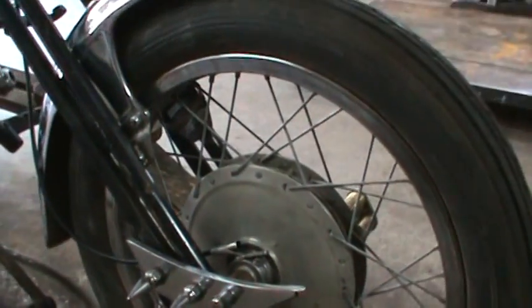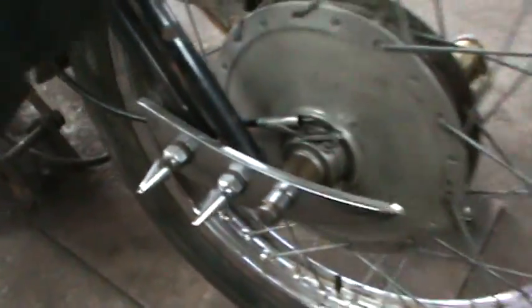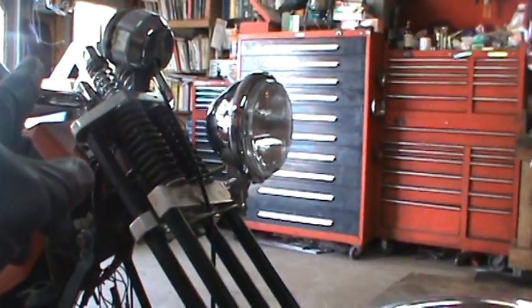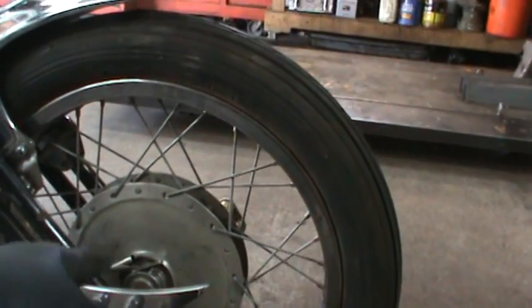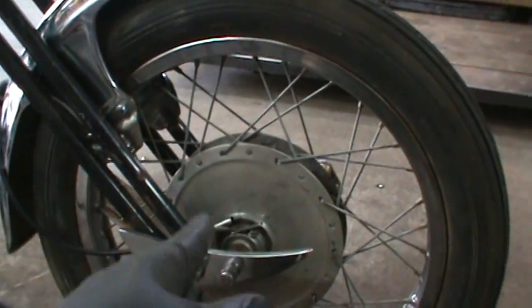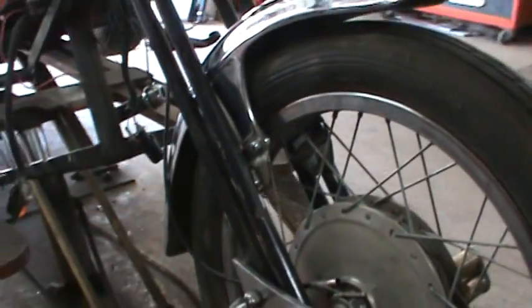And it does spin the right way, so when this is turning, I'll shove a screwdriver in there, but when the wheels turn in the right direction, if I spin that cable that direction, it makes the speedometer work correctly. And people were talking in the past, why didn't you flip the wheel over so that your brake assembly is on the other side for the levers and all? That's the reason why, because my speedometer won't work. It'd be spinning in the wrong direction.